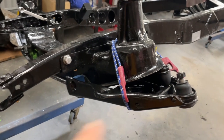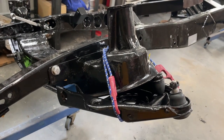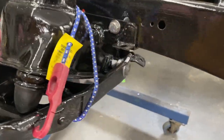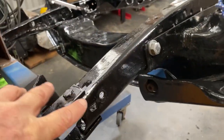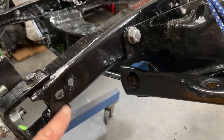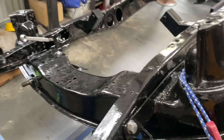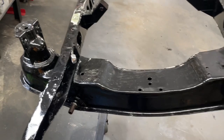I've been trying to get this lower control arm in for the last few hours. I even tried freezing the bushes for an hour or so, but I just can't get them in. I've got one side in there, but I think what the problem is, is I can't swing the hammer past this horn, so I can't get a good hit in here. So I'm going to have to take this front end out again and try and put the control arms on on the bench.